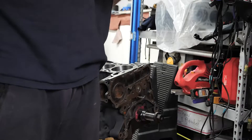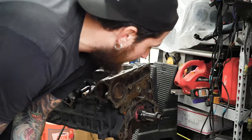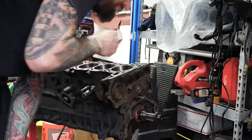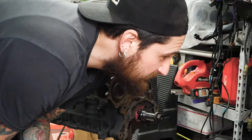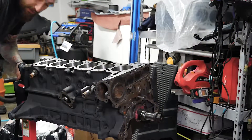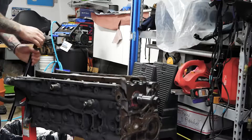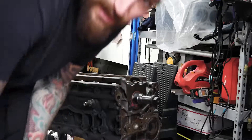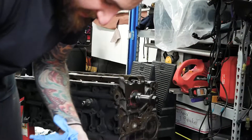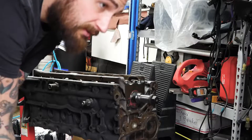I think it's go time. I'm going to blow off the pistons once again, oil the bore, and maybe put a little oil on the pistons also. I'm going to flip this over and lube up with the assembly lube. Got some gloves on, got oil for piston time. I'm going to lube these up, then flip them back over and get them ready for dropping the pistons in.